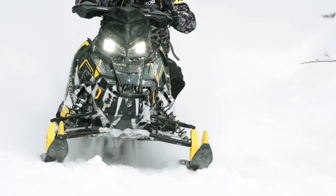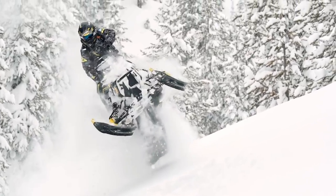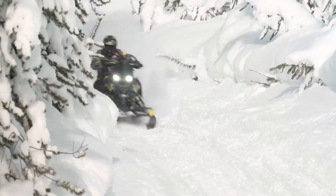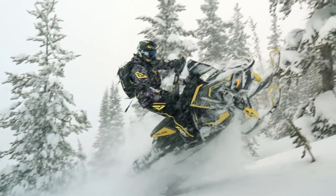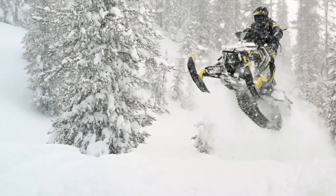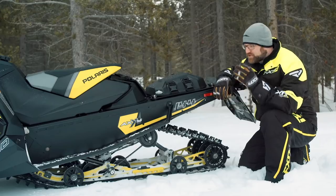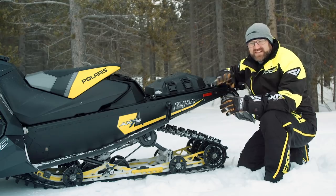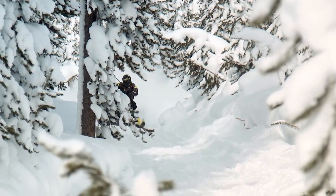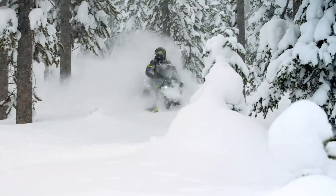Now let's move on to the off-trail bit. What makes the Switchback Assault so good off the trail? Mountain skid frames are designed to work best in deep snow, and this always comes at the expense of ride quality. So when Polaris decided to build a crossover sled, they realized early on a mountain skid frame isn't going to work — and neither will a longer trail skid. Something new was needed, and out of this necessity the IGX 144 was born. The IGX skid frame is a cross between a trail skid that provides an excellent ride and a mountain skid that provides lift and flotation. On the trail, the IGX rides almost as good as a dedicated trail skid frame. But off the trail, it provides excellent flotation and lift, and when wrapped in the two-inch track option, unbelievable traction.